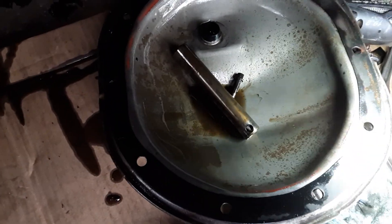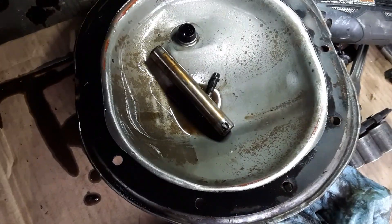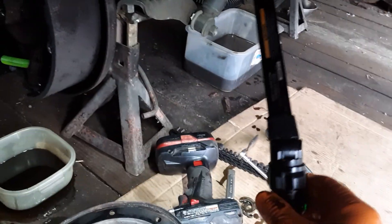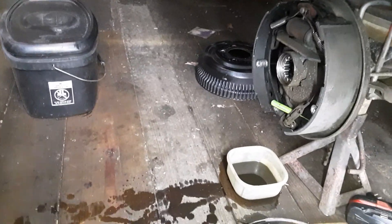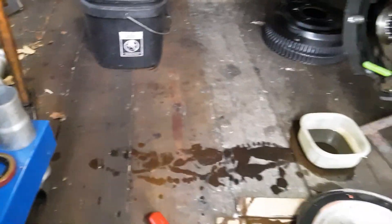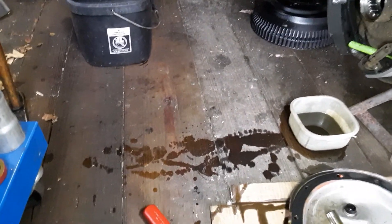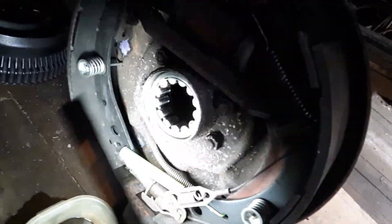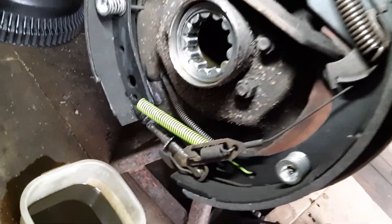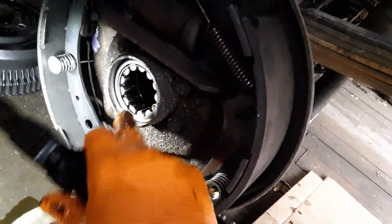The gasket was soaked in oil and it sealed up really, really nicely. That gear oil is less than a month old. I had a couple of days off and I'm going to go ahead and get this done. You want to try to clean these holes out really, really good where the seal goes — where the bearings and seals go in. There is a step back there that will keep you from driving this too far in, so it's just something to keep in mind.